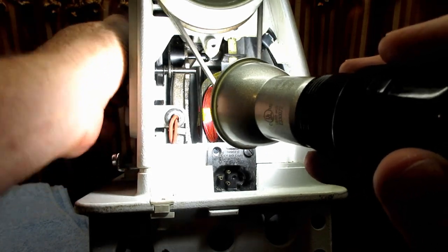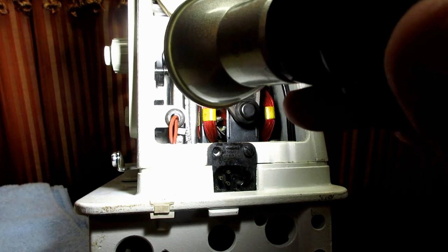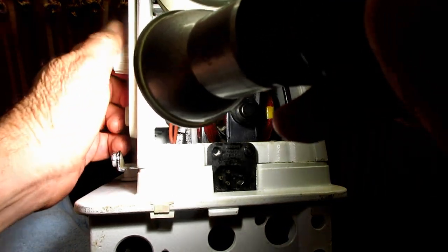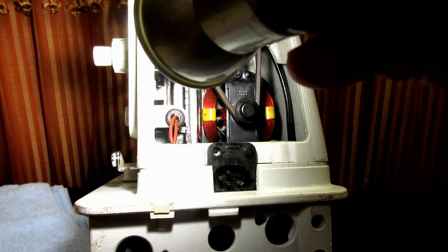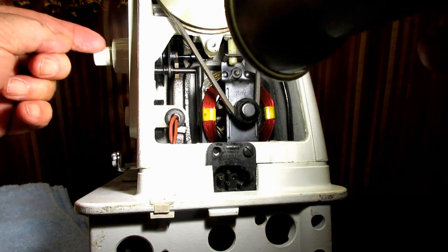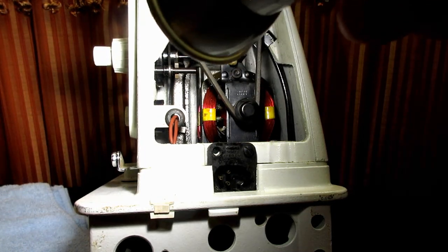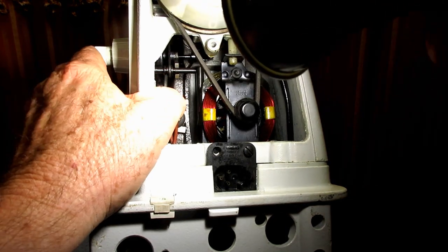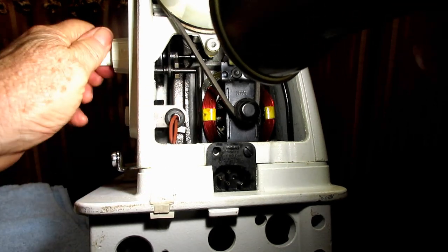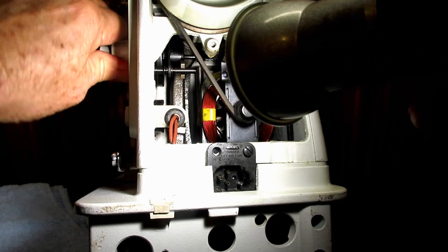And so I'm going to try it. What I did was I turned the dial in the front there to 6, the longest stitch, and I took a can of PB Blaster silicone, and right on the top of the reverse button, went pssst, a little tiny squirt in there, and then started exercising it, and it just got easier and easier and easier, and that's how I got this thing free. And it also helped with turning the dial a little bit, okay?